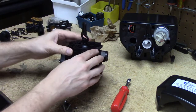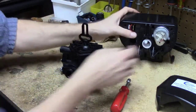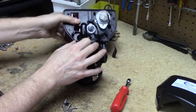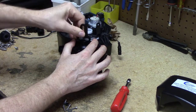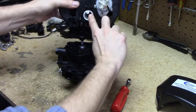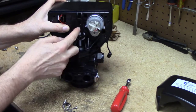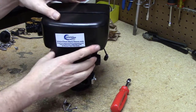Put the cover plate down and align it, then put your three screws in. When reattaching the valve body, remember the yoke has to be positioned where it was when you took it out. The assembly will move up and down, so move it up to match the post going through the hole. Once everything lines up, put the rest of the bolts back, replace the cap with its two screws, and you're done. Thanks folks!